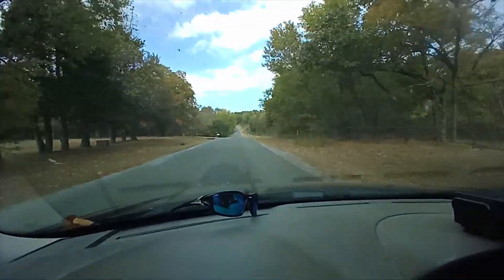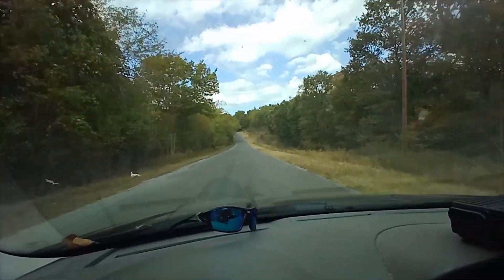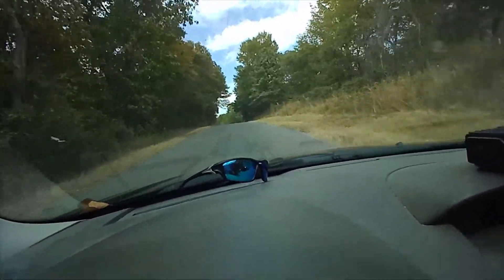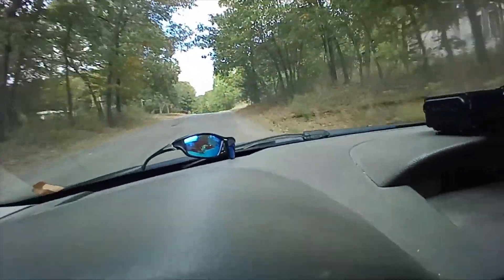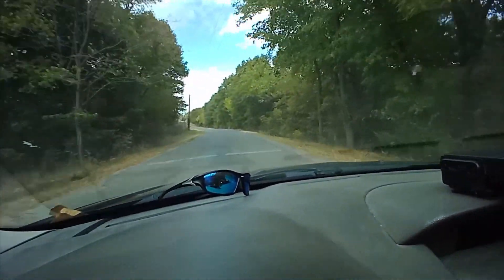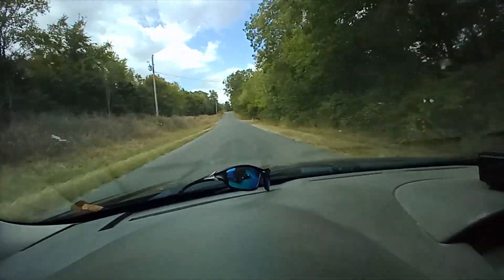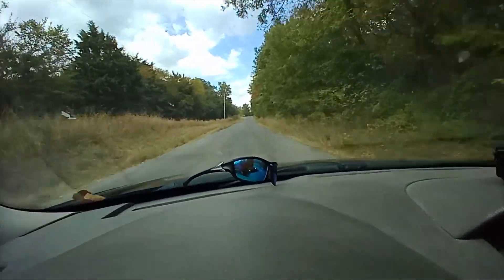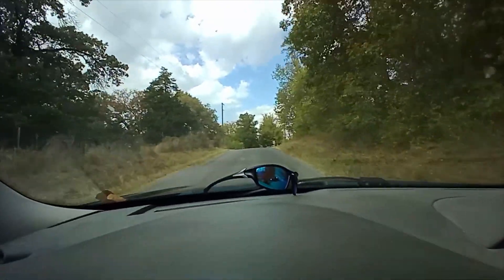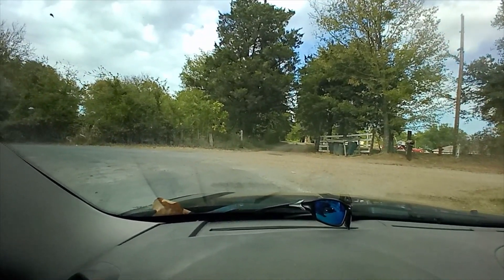The ride is a lot different than what I expected — it is a little stiffer, but remember I also put those new shocks on and I'm going down this old bumpy county road doing about 50. I really like it — I can tell there's a height difference, the back end is a little higher. I can tell this road is much rougher by the front end than the rear end. These are the green spring boosters — the 6,000-pound ones — so I'm really happy. I've been driving for about 30 minutes down the back road just trying to get a good feel of it.